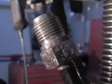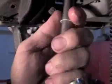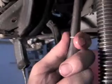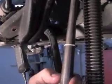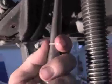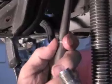But if you'll take that and put it on a punch, reference how far down that punch it'll go, and you'll want to just work that real gently down about another 1/4 of an inch. And do it slow because you're stretching that Teflon. If you do it fast, you can pop it. And you don't want to get carried away and slide way down here, because sometimes they can go this far before they'll pop if you do it in the right temperature. But if you'll just work that down about a 1/4 of an inch, a little bit at a time, it'll give that Teflon an opportunity to stretch without popping.